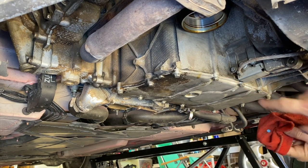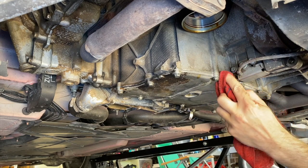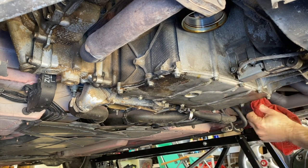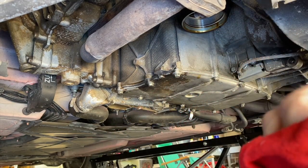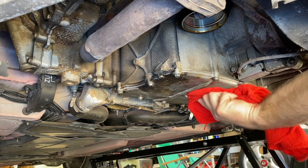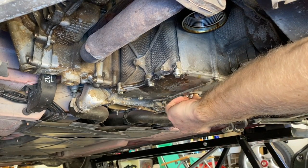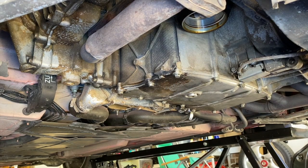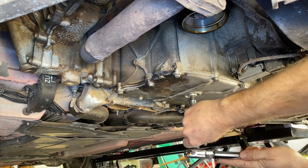Where the extra gasket material is coming out the sides, you can feel free to wipe it down - it doesn't do any good on the outside. With a clean rag, make sure that drain plug is cleaned up and the drain hole is all clean. Hopefully you bought a new crush washer when you bought your filter. Tighten your drain plug with the torque wrench - it is 50 Newton meters or 37 foot pounds. Hopefully you didn't find any bits of metal in your pan like I did. Please give the video a thumbs up if it helped you, subscribe to the channel for more cool content, and we'll see you next time.